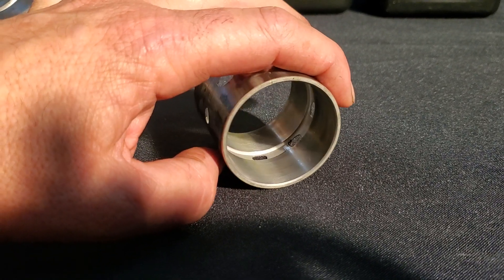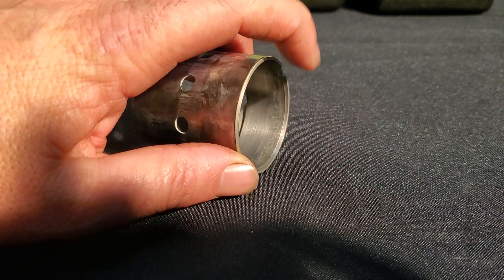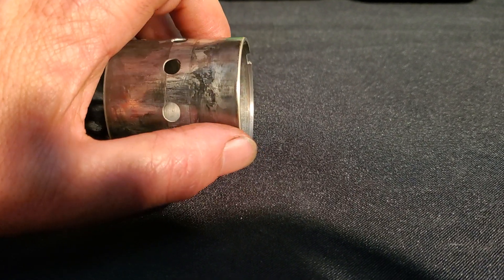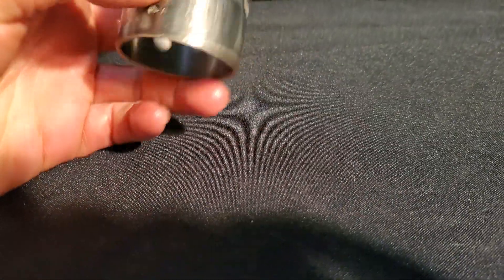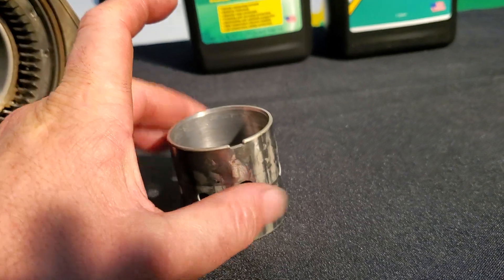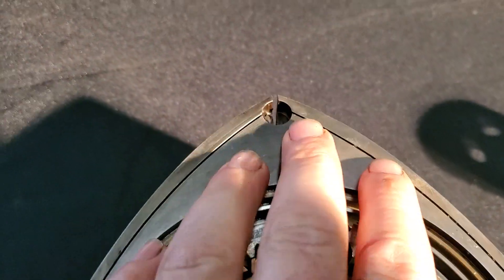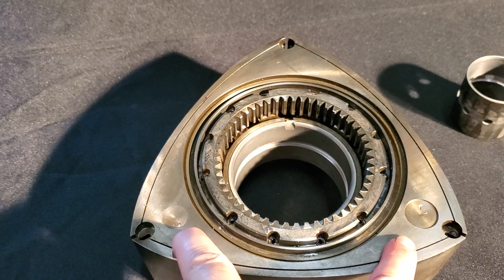I think it might be worth looking into improving my oil filter situation, although we are running competition Wix filters. This is the back side of the bearing, where you're going to have more wear as the eccentric shaft flexes on 20Bs or 13Bs at high RPM. You can see I've got just the tiniest amount of babbitt color showing on the back end of the bearing, but basically no slippage — pretty typical looking bearing. That's amazing because this is not a typical motor or car. Also, we have absolutely no side-tip rotor interference going on.